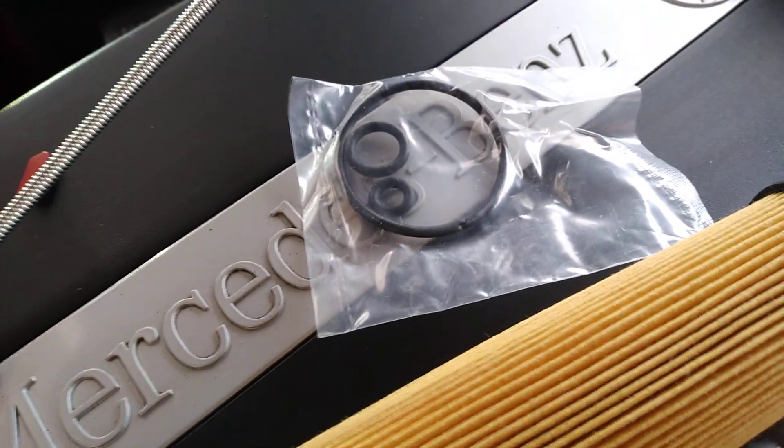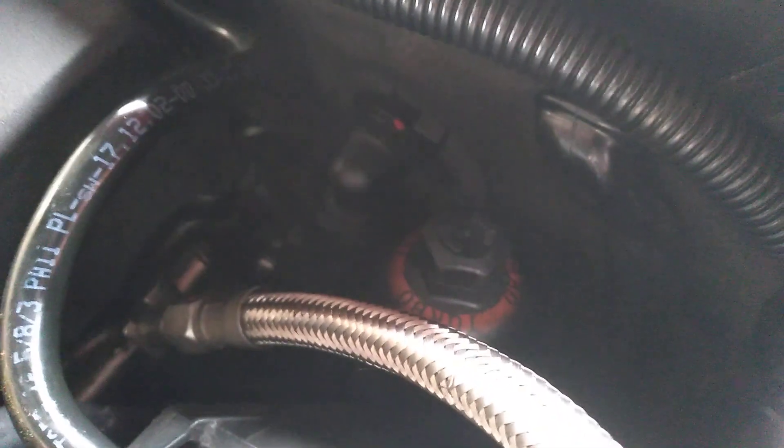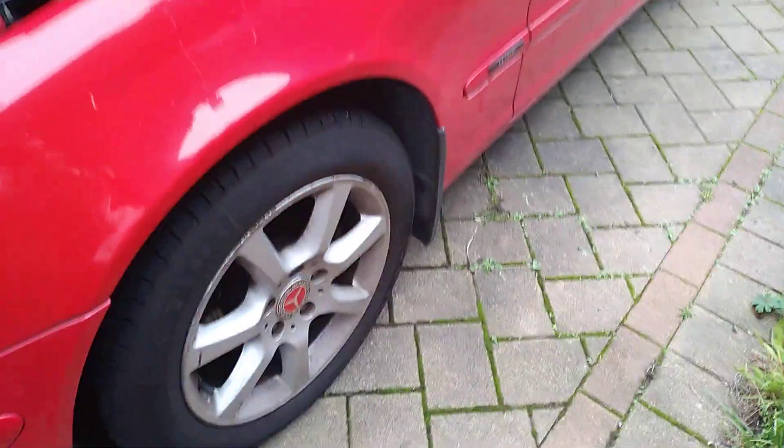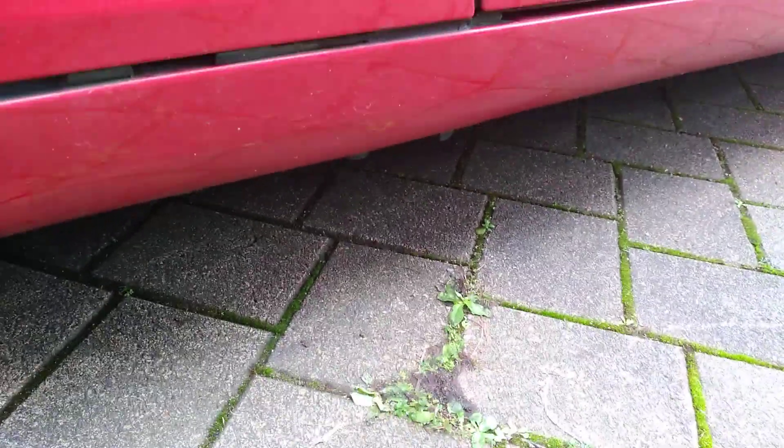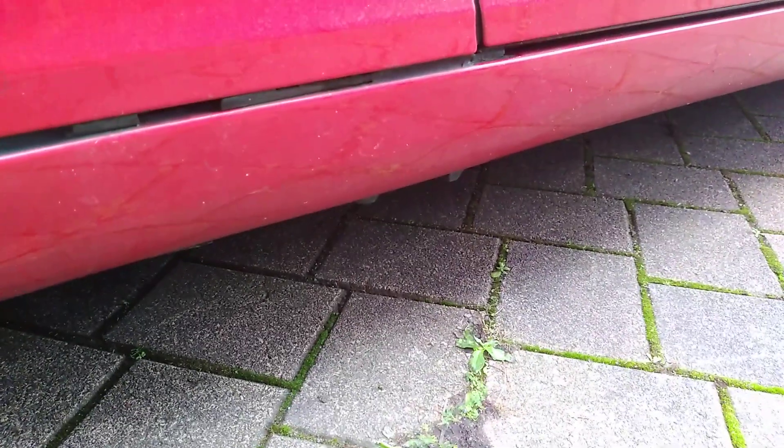The big O-ring replaces the old O-ring on the cap. Put it back into the car - actually I'll leave it out a little longer. Now I need to get under the car. I get my trolley jack and slip it down to the jacking point, raise the car up a little bit, and stick my axle stand under the chassis so I can reach under to drain the oil. It's a 13-millimeter plug, so make sure you've got a 13mm socket.